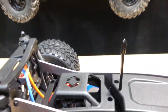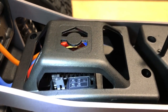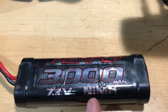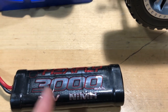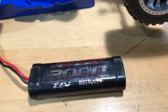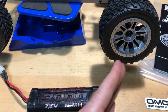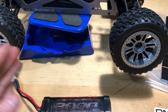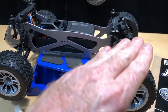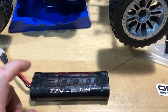Right out of the box, the ESC is set to NiMH - it even says NiMH on the jumper. These NiMH packs have six little batteries in them. They work, but they're not going to give you as much run time and the power isn't as linear. What I mean is, with a LiPo you can go fast longer, whereas with NiMH the performance just declines as the battery drains - it just goes down, down, down.